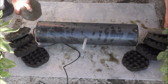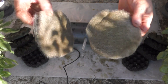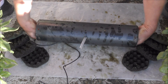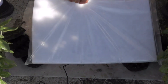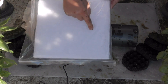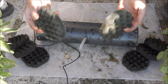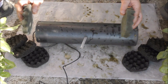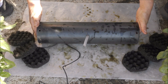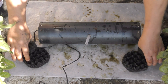The next thing to go in will be a fine pad. These ones have been in for a couple of days in that container, so consequently they've started to get filthy, but they've still got a bit of life left in them — so they go in. That's what the pad would look like when it was new. I sell these on the website; this one is 11 inches by 17 inches, so you should get eight four-inch circles from each pad. Next thing that goes in is a medium-density pad — they are filthy as well, but they used to be blue. You can see how much crap they've collected. They go in with the bumpy side facing out towards the ends — that's important. Bear in mind, our water's going to be drawn in from the ends, and it wants to contact the side of the foam that's got the greatest surface area, which is the side with the bumps on.